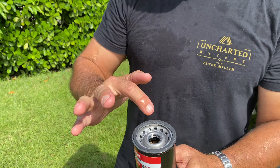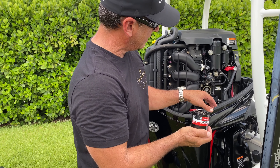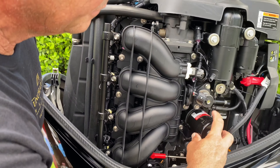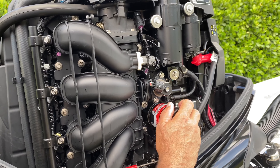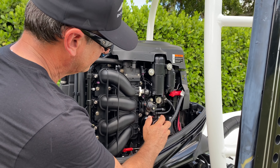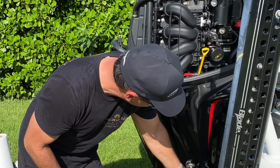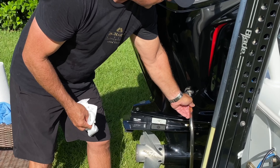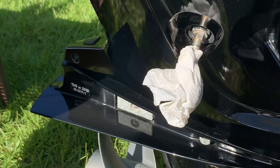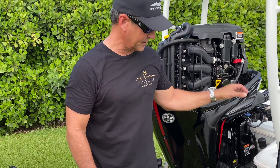This is the fresh oil — I'm going to rub that on there, and we're going to put the oil filter on. As soon as we get that in place we're going to add five and a half quarts of oil. As you can see the oil has finished draining — there's no more oil coming out. So what I like to do at this point is remove the half-inch hose and take a piece of paper towel and just cram it up in there. We're going to have to close this fitting, otherwise when we pour the oil in it's going to come shooting out.